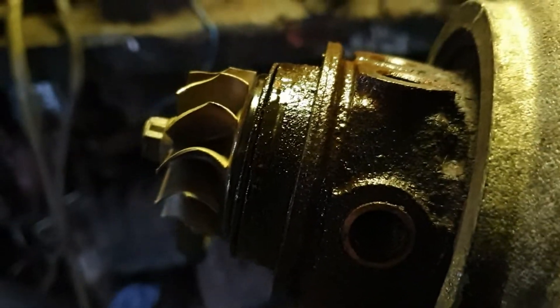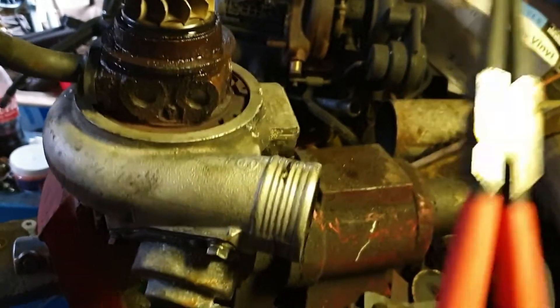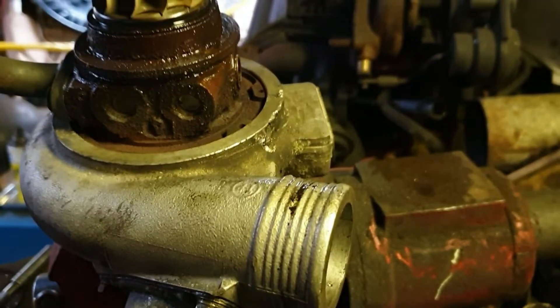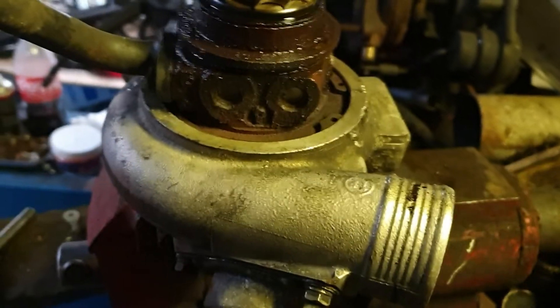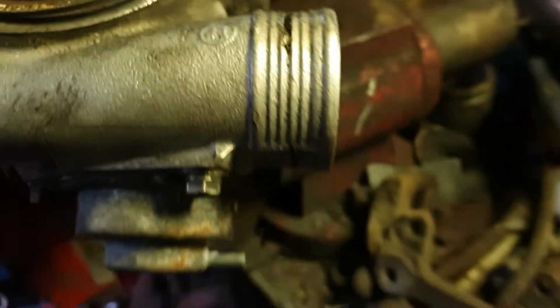There you go, it comes out. As you can see it has to work its way through that sort of stuff. Now that we have room for the circlip, first of all make sure you have a circlip that will actually fit in there, and second of all move it a little bit first with a hammer and punch, otherwise you're in for a rough time. Clean it as much as you can — give yourself every chance possible. If you're putting these back together, scribe them the right way so you have a rough idea where they go back.